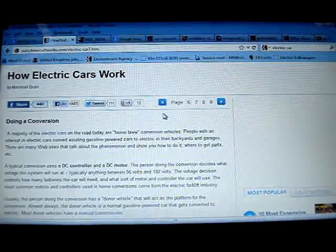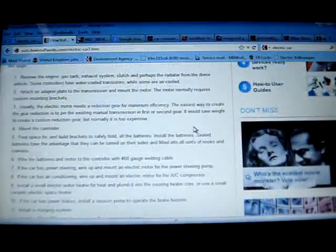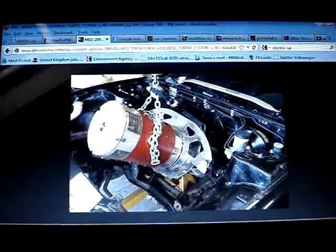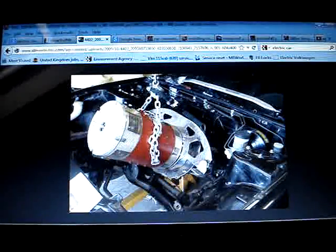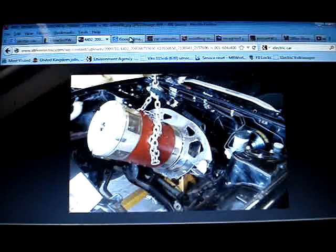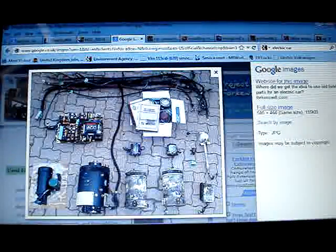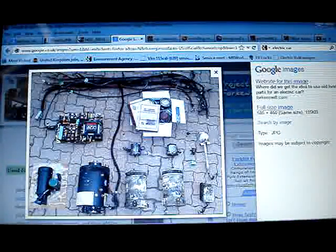I'm on a budget, on a mission. I've been doing research, found loads of information. Every night, more or less, researching, reading, speaking to people, emailing and doing every possible thing you can imagine. We've got a motor — just a DC electric motor — connected to a gearbox, and it goes straight into the car. Very straightforward, simple technology: motor, controller, throttle pedal, little bits and bobs, contactors, relays, instruction manual — that's all you need.